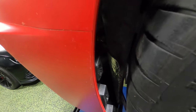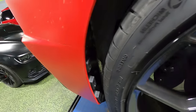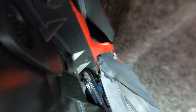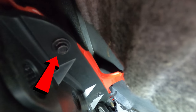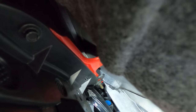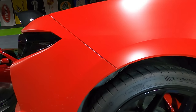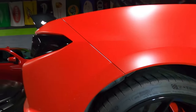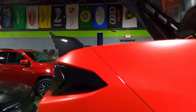Once you remove the two T15 screws that go into the fender well, you can pull it back. Then we go up inside here and you can see right there is one seven millimeter bolt, another one right behind it, and then at the very top there is a 10 millimeter nut. Those are the three fasteners holding the back of the bumper to the rear fender. Once we take those three out, the entire bumper will be able to come away from the rear fenders and we can start working on getting that high wing installed.